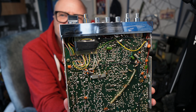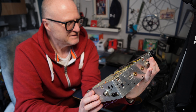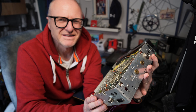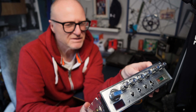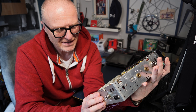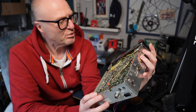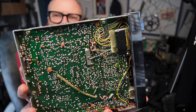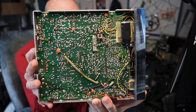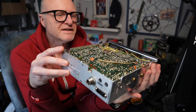The biggest shock horror is this EPROM on top — I'm not keen on placing an EPROM there, it really should have been inside I think. It's a bit sandwiched, but obviously whoever fitted it just made it easy for themselves. I think it's still performing but I just think it's a bit of a stretch for these 879s — six banks, I just think it is. It's had one of the outputs changed in the past, there's a bit of work around here, but apart from the EPROM it's actually quite tidy. I don't know why anyone would want to wideband a 879.